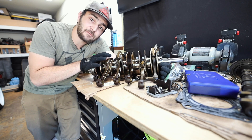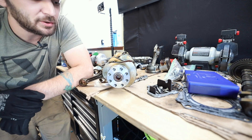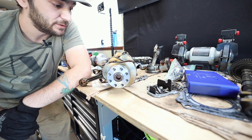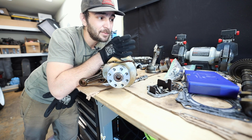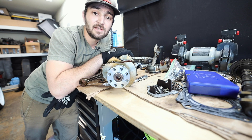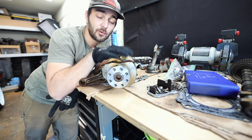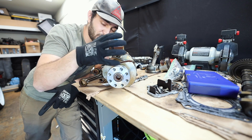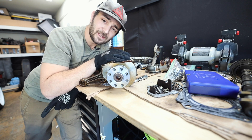On the back side of the crankshaft you can see a circular bolt pattern — this is where your flywheel bolts up, and the clutch assembly sits against the flywheel, which is what delivers power to the wheels. Timing plays a huge factor in how the engine operates. Without proper timing, the intake and exhaust valves won't open at the right times to create the mini-explosions inside a compressed cylinder needed to move the crankshaft and make power.